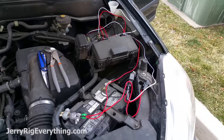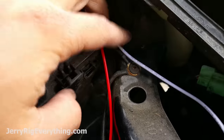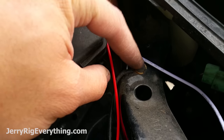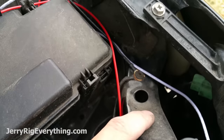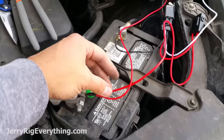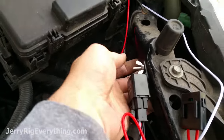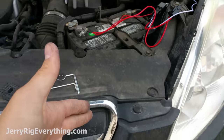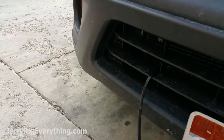I have it all wired up now. From the switch you've got the wires coming through the firewall. This is the ground — there's just a screw on the frame that was already grounded to something else so I just put the ground in with that. If your lights are dim or not functioning correctly it might be because the ground is not good enough, so make sure there's a clean ground anywhere on the metal frame of the car. You might need to scrape away some of the black paint to make it a better connection. With the battery I had the two red cables going to the battery, the one black cable going from the negative to the relay. I found a pre-drilled hole in the frame, had an extra bolt, and just stuck the relay and screwed it in. Then you have the other two lines — one goes to that light and the other comes to this light right here which I'm going to install right now.